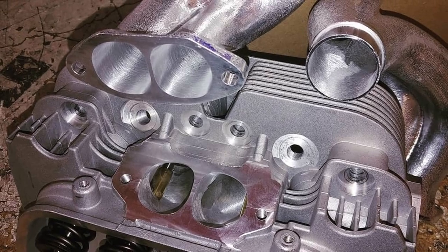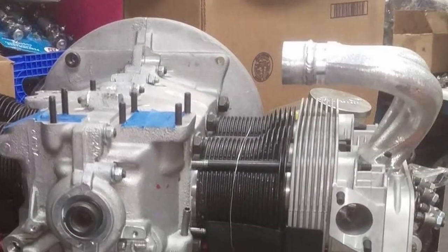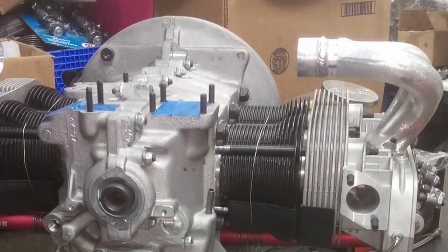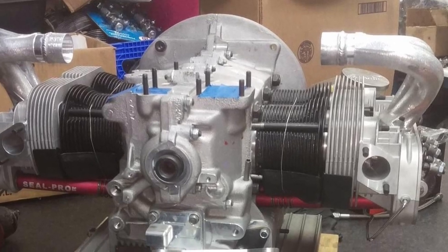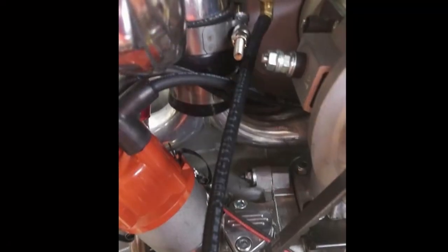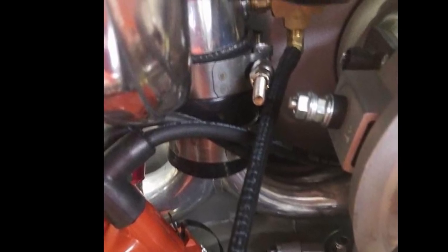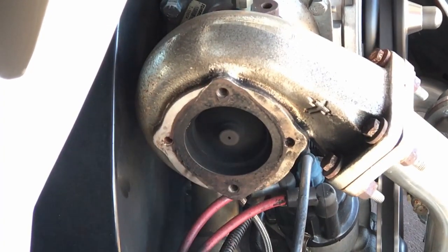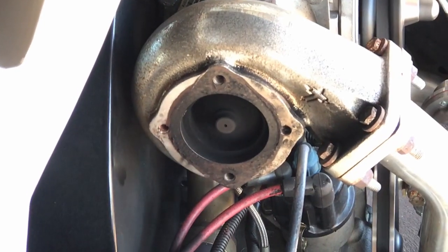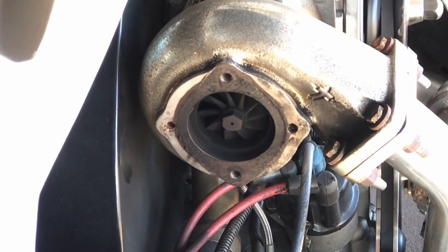This shot is just marking up the inlet manifold — you can see the inlet is now bolted to the long block. The last shot is where the inlet manifold comes together and goes up to the turbo. The turbo on V-Dubbed is a Turbonetix T3-T4 hybrid, meaning the turbo has a standard T3 turbine component combined with a slightly larger T4 compressor.